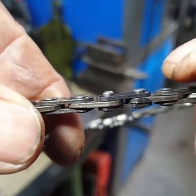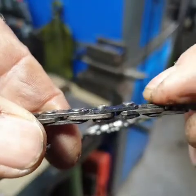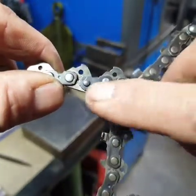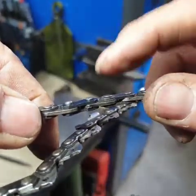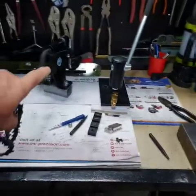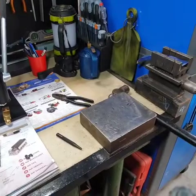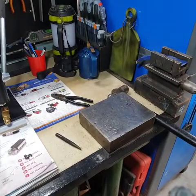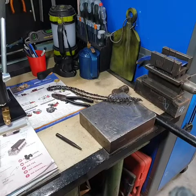Even though if you look here, this one was done by a machine — it's much neater and the diameter is a little bit bigger. That's only because it was done on a spinning type machine. So if you use one of these spinning machines, you get a much nicer flare. But the moment that you flare, even with a ball-peen hammer, the rivet will never come out.